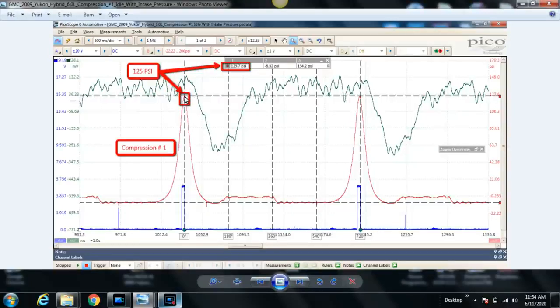So here, top dead center compression goes to bottom dead center during the, again, conventional power stroke we call expansion stroke here. The next stroke from bottom dead center to top dead center is the exhaust stroke. Well, in the expansion stroke, before the exhaust stroke, the exhaust valve opens. That's what happens here. The exhaust valve starts to open here and remains open during this entire exhaust stroke into the intake stroke. That's cool. That's the way it should be. This is a good cylinder.